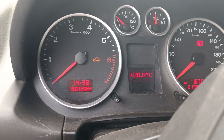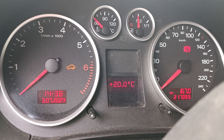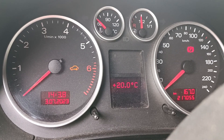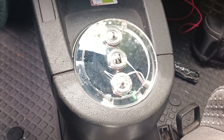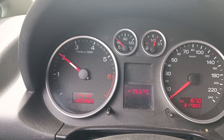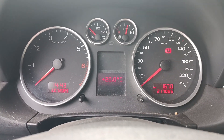As you can see while charging, the car is basically fired up. We're using the fuel gauge as intended — to show the battery state of charge. The rev counter shows the regen level, and I'll show you that in a minute on a test drive. To drive it you still need the key and turn it on, which powers up the car. We made a little gear selector: pushing here puts us in reverse gear, and the rev counter shows we're ready to drive and in regen level two. Going back to neutral, the car is no longer ready to drive and the power steering pump shuts off.